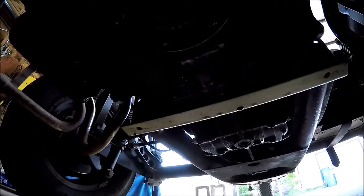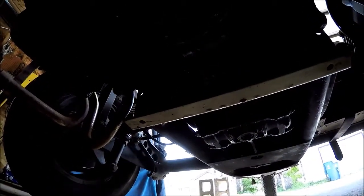There's still oil coming out from underneath my trike — it's not as bad as it was, but it's coming out not from where I was expecting. It looks like it's more between the engine and the transaxle, which means probably a rear main seal. I don't know if I forgot to use RTV or high-temp gasket sealant around that main nut going on to the motor, or maybe I didn't tighten it enough and it's coming loose. I'm losing a lot of oil — about half a liter in a hundred miles.